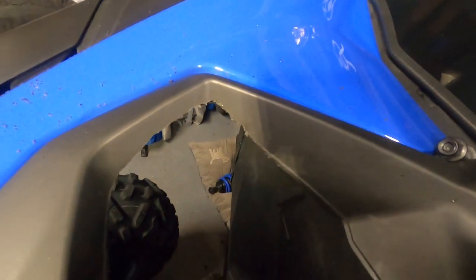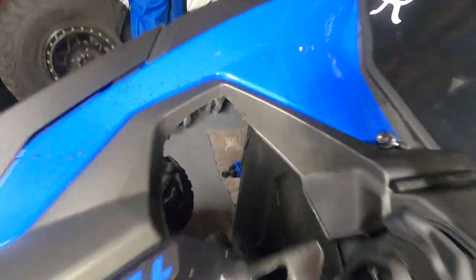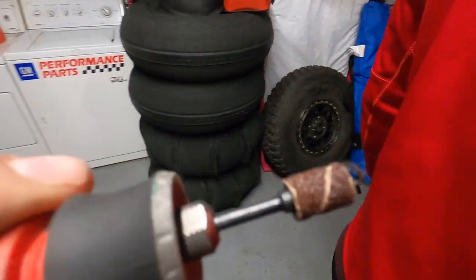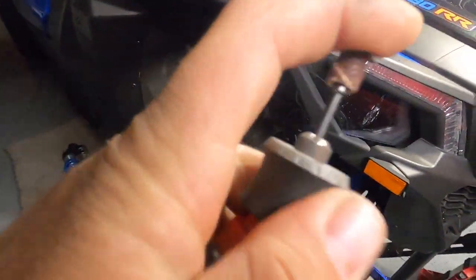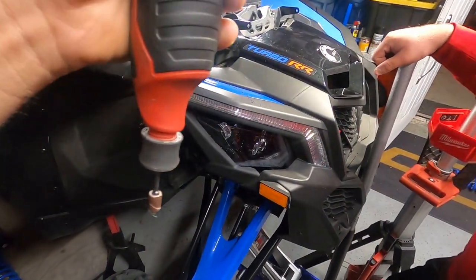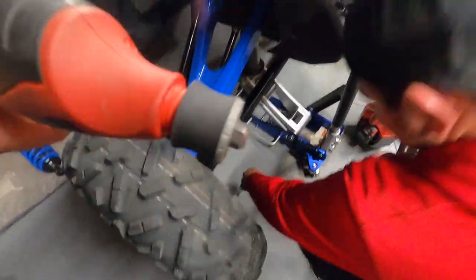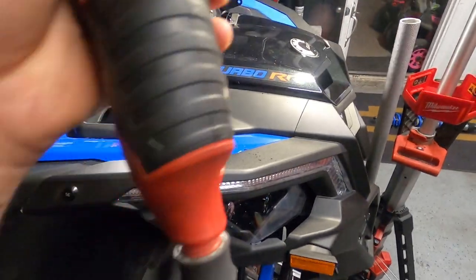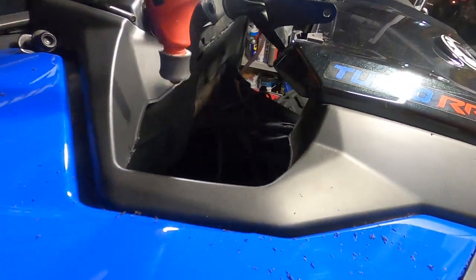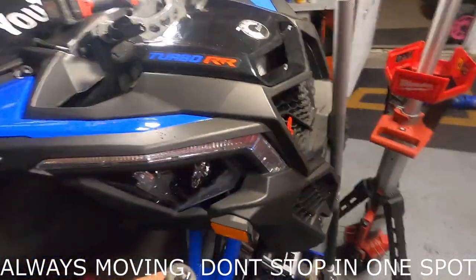I did a rough cut — this is factory right here and this is the rough cut I did. We're taking away some material, but at the end of the day it's going to look good. The sanding wheel leaves a nice clean edge. The trick is to make strokes without stopping — if you stop in one spot the plastic starts overheating. Take quick strokes, keep going evenly, don't apply a lot of pressure, and it'll come out real good.